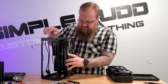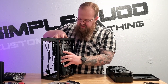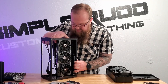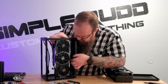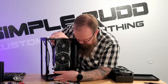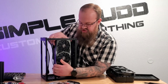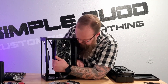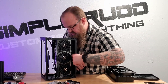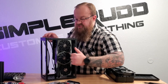Hooking this guy in, you gotta slide that up in there, then slide this sideways. Make sure this is in the up position — it's not like your normal latch slider, which is a little unusual. But then your graphics card should just slide right in there, just like that. Then you can push this down to lock it in place. And we're locked.